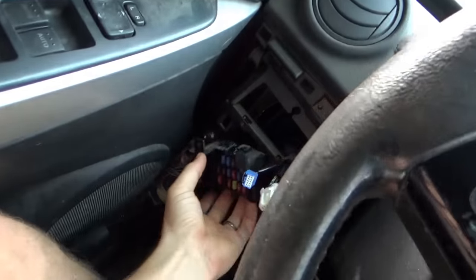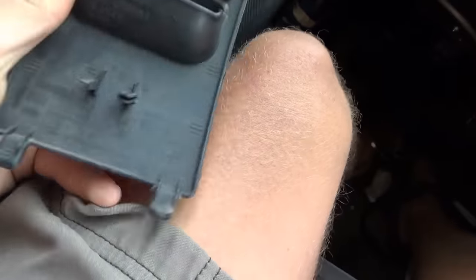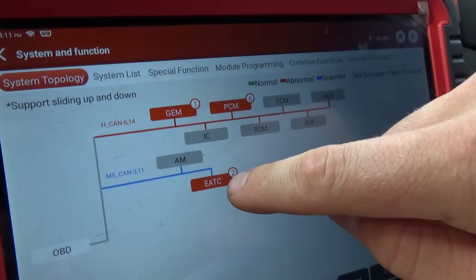The shop owner here, Don, did a quick check. The meter fuse that powers up the instrument cluster in this little fuse box is missing right now. He said that blows as soon as you turn the ignition key on. So that is a great direction to start with. Let's pull up a wiring diagram, see what that fuse feeds, and then install a high-amp test light between four or five amps to see if there is a short circuit to ground on that tree.